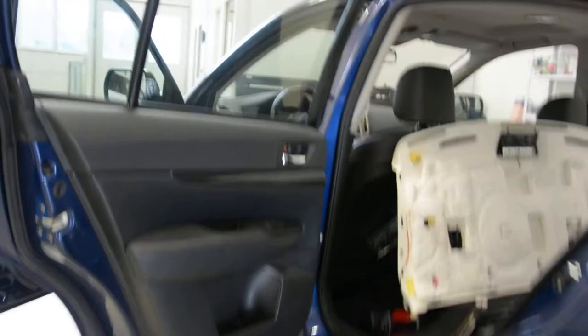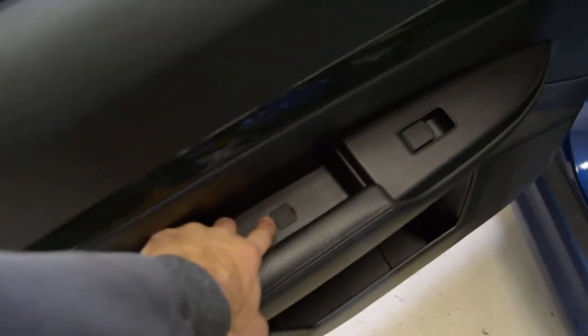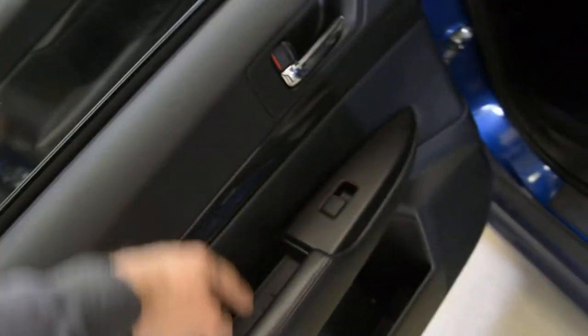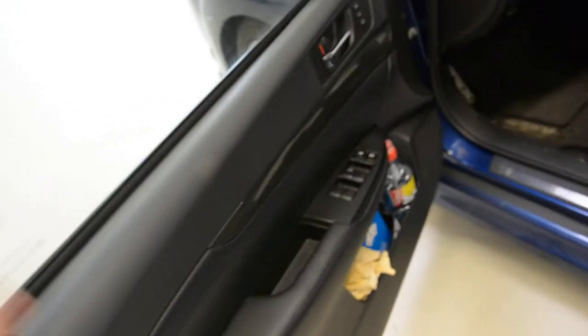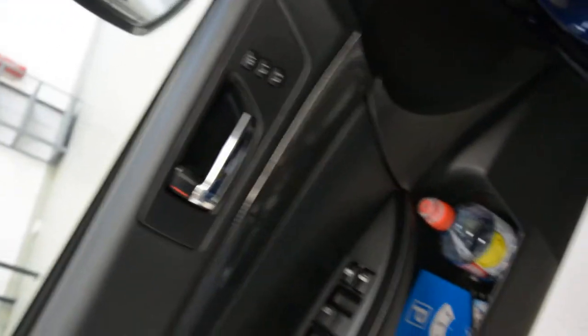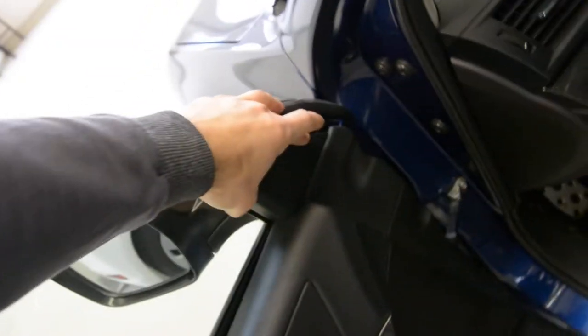I will show you — you will have two caps, one here and another cap here inside. Under this you will have two screws, cross screwdriver screws. On the front door it is the same thing, one here, one here, and what you will have extra on the front door is this thing, but it is the same.